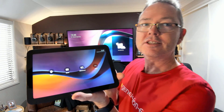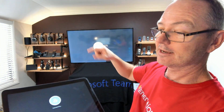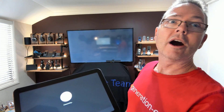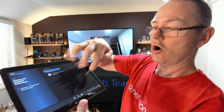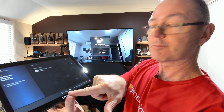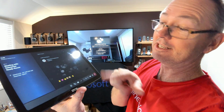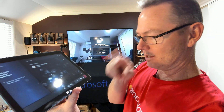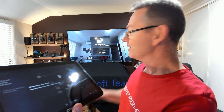Very easy and straightforward. Now we've got a bunch of features — I'm going to walk you through them quickly. We've got our Meet Now button, which as soon as I touch it, the camera jumps to life and we're connecting, ready to meet now and add more people. I'm going to disconnect that real quick — you can see the standard MTR-type behavior. On here I've got my usual controls: display layout change, actions like raise hand with all the emoticons released in recent months, and a sharing button. If I go to connect device to share, it says you need to connect via HDMI — but as I said, there's only one HDMI on that 3T unit, so we won't go there.